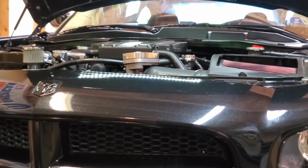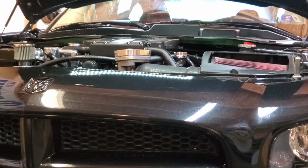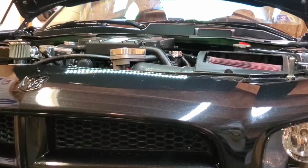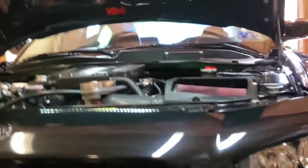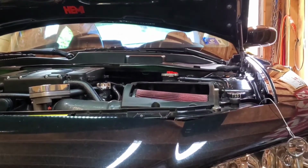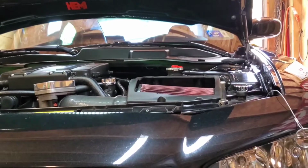But then again, I did have less pressure in my rear tires than what I normally would run. That plays a part in your mile per hour and your quarter mile, for those that don't know. But it would vary some. It's not going to be drastic. I mean, it might be 2 to 3 mile an hour tops. But then again, from the mile an hour standpoint, the car's got the torque out of the hole in about mid-range, then it kind of plateaus because it doesn't have enough horsepower to keep it pulling, if that makes sense. It will some, but that's what I think.